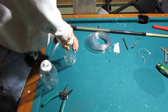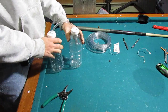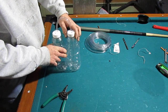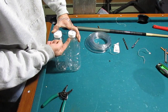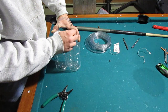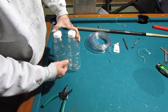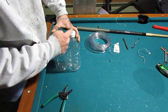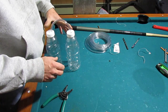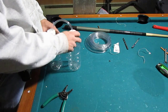We'll bring this down all the way to the bottom and then back it up just a little bit. In essence, we're going to have a liquid connection between the two bottles — these will be taped together. We'll have a single hose dead-ending just below the cap going to one carburetor, and another hose going to the other carburetor. When you fire it up and run it, whichever cylinder is pulling more volume of air will create a vacuum and the fluid will shift through the tube. We'll then dial in the idle screws. By the time we're done, you're going to know how simple it is to synchronize carburetors — it's very, very simple.